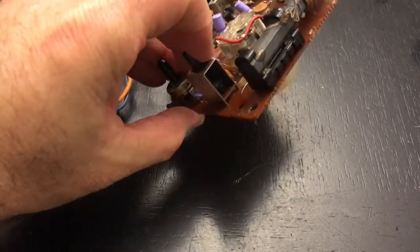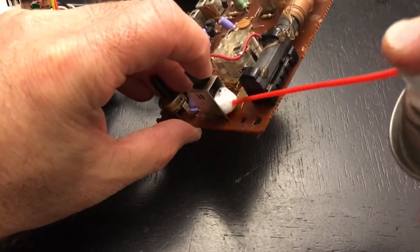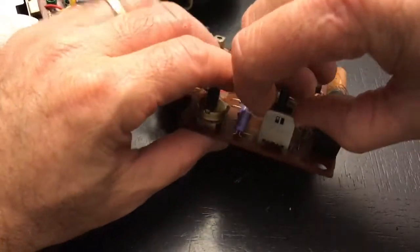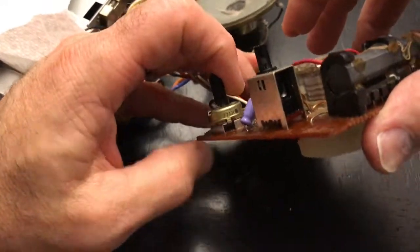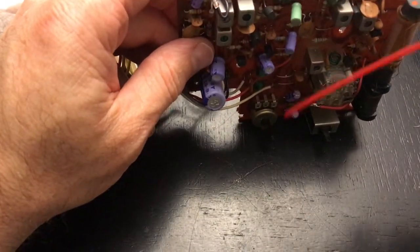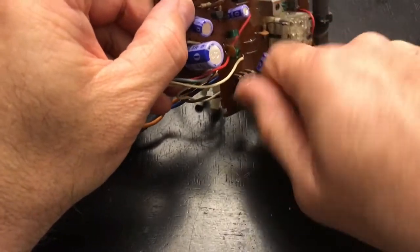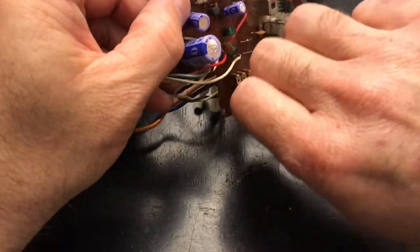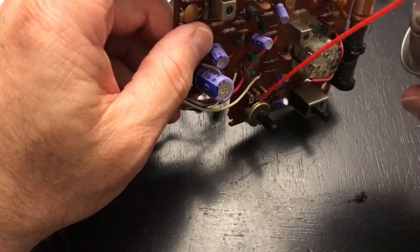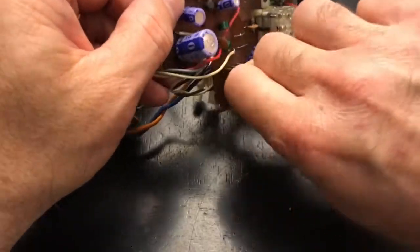Here's our AM/FM selector and I'm going to show you where to squirt this stuff - electrical contact cleaner. You want one that says it's plastic safe; there are several brands. It's the secret sauce - it takes a radio that's not working or a volume control that's staticky and fixes it. The volume control is called a potentiometer. Squirt it right down in there, then turn it back and forth all the way down and all the way up - you're cleaning out dust, garbage, varnish. This is generally all it needs.